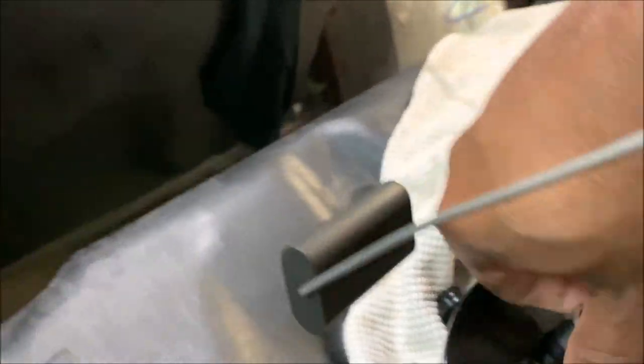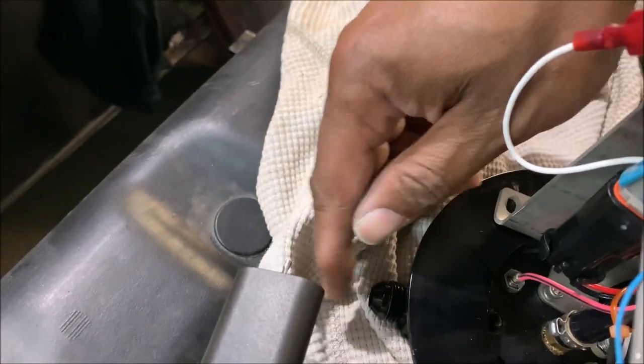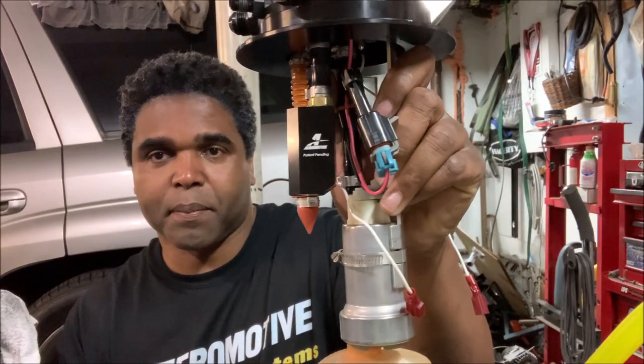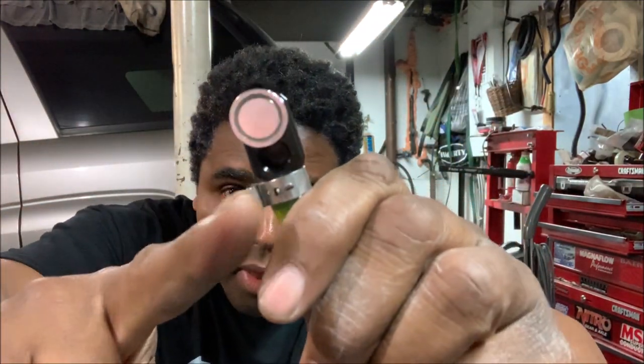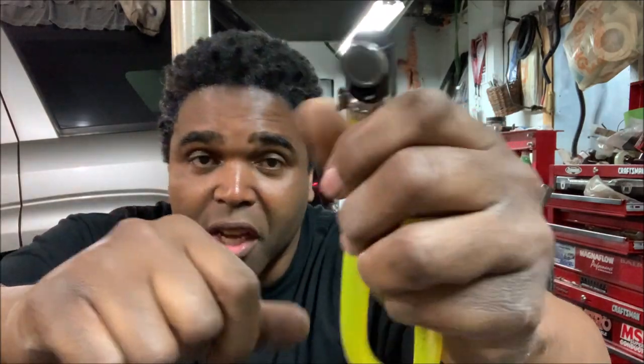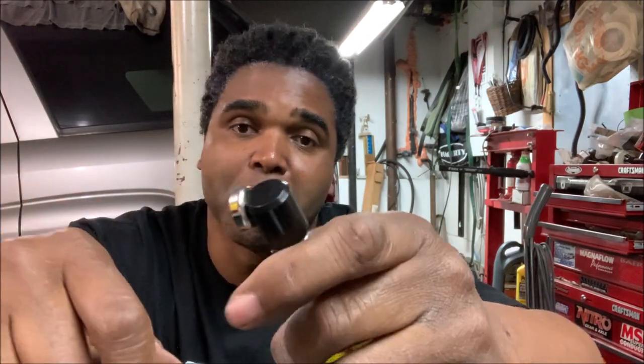Check this out — flip the unit upside down just like this. There's an opening right there; it's closed off, but I know this is the right size so I'm gonna just twist it out. As the fuel goes out, it will create a vacuum where we're gonna install that siphon. The Apex kit also comes with this hose, and this hose is kind of special. The opening right there is for the fuel to be sucked in, go to the Apex, and drop right into the bucket.